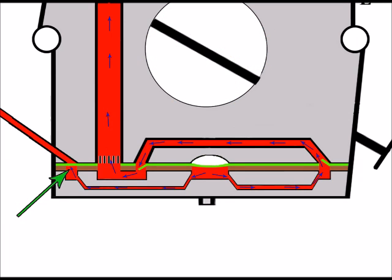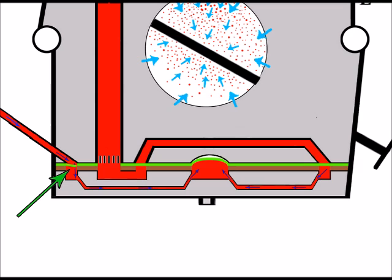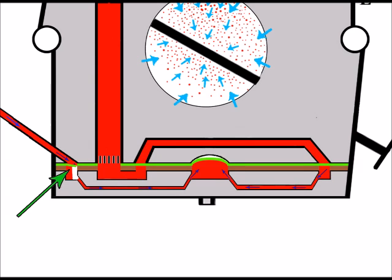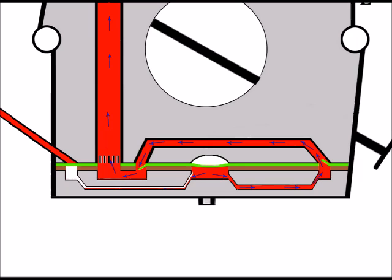of fuel air mixture. So when these diaphragms do age, or they're made from a substandard material, what happens is they go stiff and rigid. And of course, when the diaphragm goes rigid, so does the valve, because that's part of the diaphragm. And if you look at the valve now, it's not opening up as much as it did. The fuel flow coming in can't move it so far because it's more stiff. So now, if the engine revved to high revs, it wouldn't be able to get enough fuel for what it needs. And you can see there's a lack of fuel coming in through that valve there.